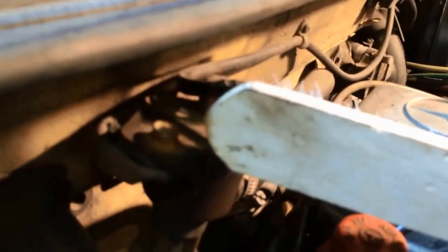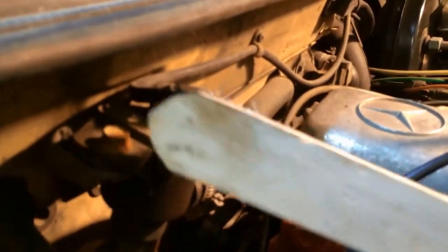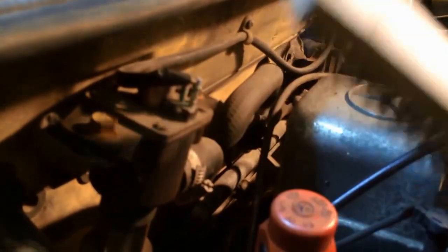Now, as you can see right now, I'm just kind of gently scuffing it. You know, my careless ass, instead of taping, I probably should have just held on to it. That's my dumb ass, but oh well. So I'm going to slide these back off, and I'm going to clean these posts and put some dielectric grease on them, and tape them up with electrical tape. And I'll be very careful of this. But that's what's going on. So that's just an update.